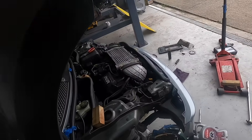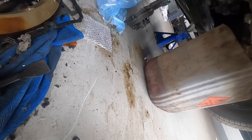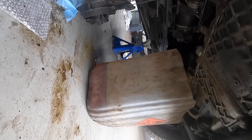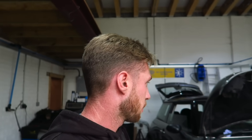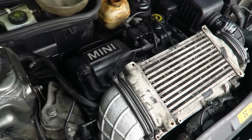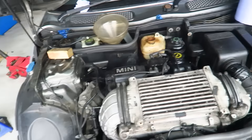It's not got any water in so we are going to stop it there. Now we need to go through the bleeding process - it absolutely stinks because there's oil all over the place but I'm happy with that. I need to put the radiator hose back on and a few things back on ready for coolant. She runs! So the next test is putting water through it and making sure she still runs without misfiring. We're going to use tap water for now, run it through and bleed it with the bleed nipples open, heater on full inside - this will also flush out any debris.